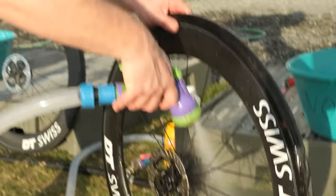I'll be honest, sometimes I just wash my bike and put it back in the garage — why shouldn't we do that? Not a good idea because obviously it can go corroded and you can get all seized parts. What we're looking to do once it's dried off is make sure there's an application of bicycle lubricant onto the chain. I'll also put a nice light Teflon lubricant on the jockey wheels and a little bit on the cassette as well. What are you using to dry the bike? Just a normal towel. Normally if we had the race truck here we'd have a compressor to make things quicker. The weather's good here so the bike's pretty dry within about 10 to 15 minutes. In a really wet race I'd be there with a compressor blowing it all off, a towel, and then finishing with a nice polishing cloth.